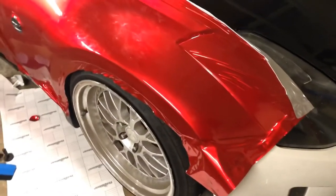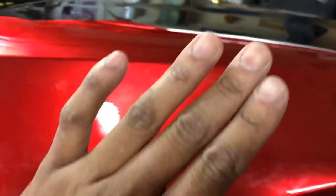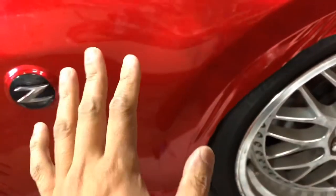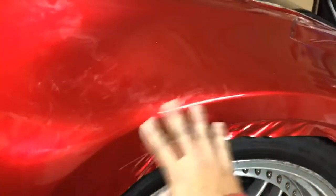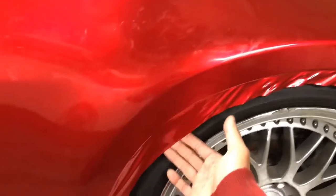Here is how it's supposed to look when it's done. When you get to the curved part it starts to want to lift back, so you really have to heat it up nicely and slowly use your palm to work it forward and then down. Once you get to the bunching area, bring it out at an angle, heat it up, and pull it down over — it will lay smoothly. Then you'll get some wrinkles going across the fender; heat it up, reach under, and pull back.